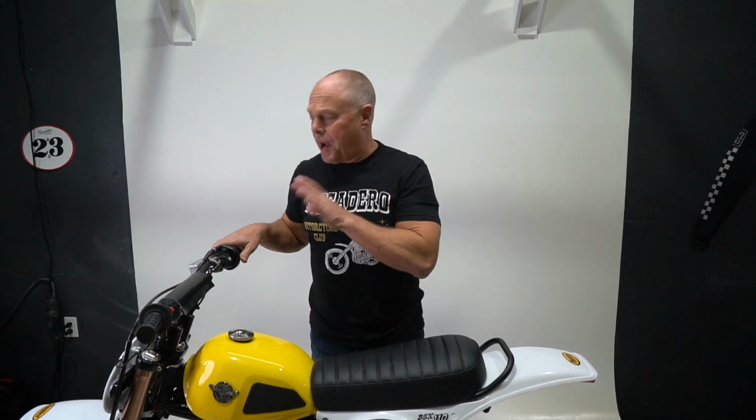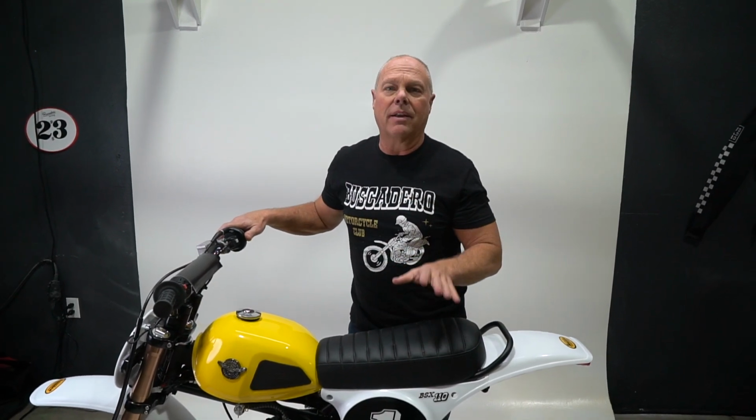Okay, if your bike's running like that, it's not a big deal. It's very simply a lean carburetor condition, which means there's too much air and not enough gas getting into your bike. If you live at around 2,000 feet above sea level or even lower, that's very likely the case. It's an easy adjustment, and in this video, we're gonna show you how to fix it right now.